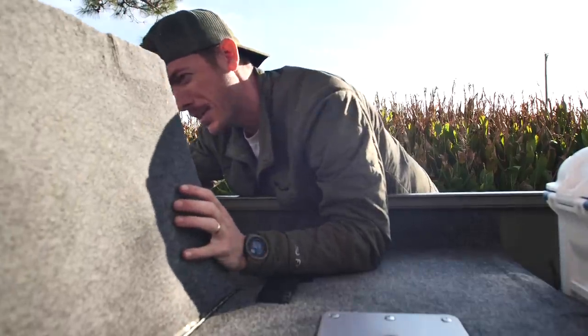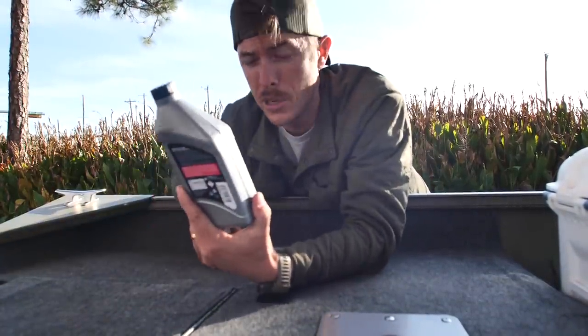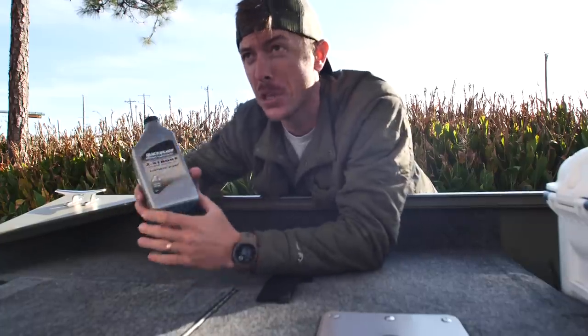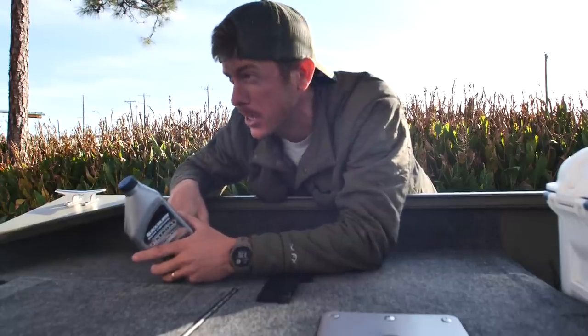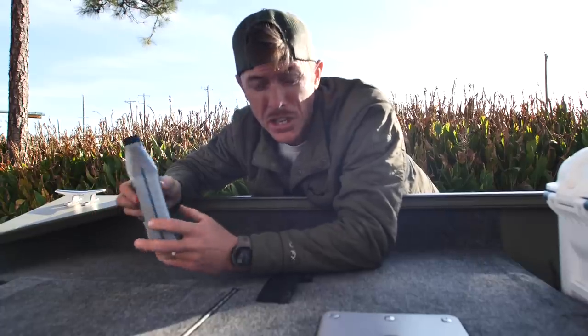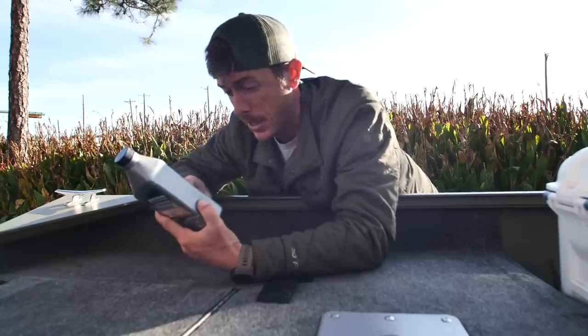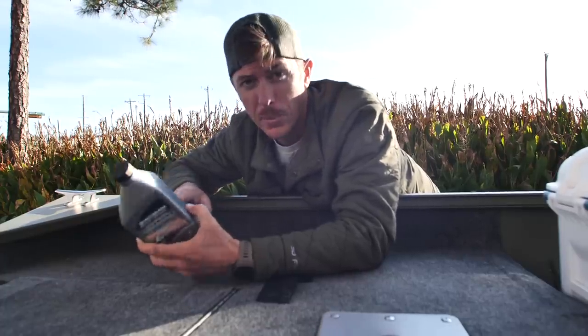It's not going to stop me from getting out on the water and making this maiden voyage. There's really no gas in here, so I've got to fill it up. I'm going to be using two-stroke oil — I have to blend my oil with my gasoline, and it's a 100-to-1 mixture; it says it right on the motor. I'll do about six ounces in each tank and then fill it up — ten gallons total.